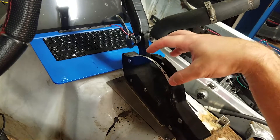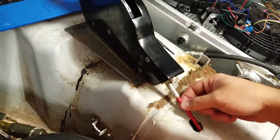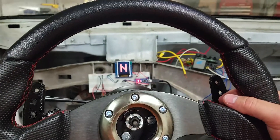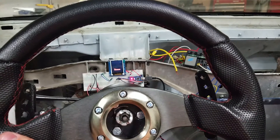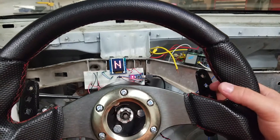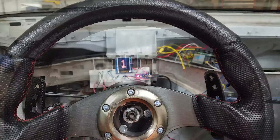Right here I have a little box with a 12-volt DC linear actuator. It will actuate the shift cable for me — when I press the toggle it will move the shift cable. Right now I have this programmed for an automatic, but I'm going to have it programmed for one with a reverse manual valve body, so I go from neutral to first to second to third. It's just not set up yet.